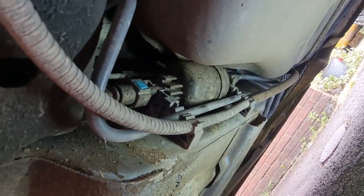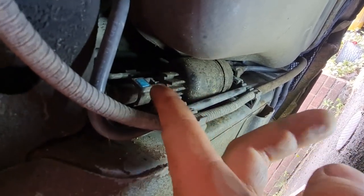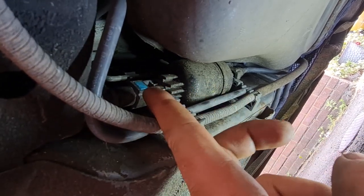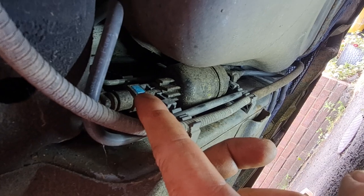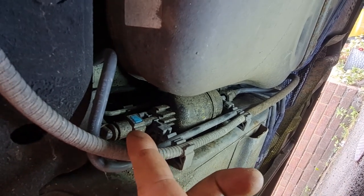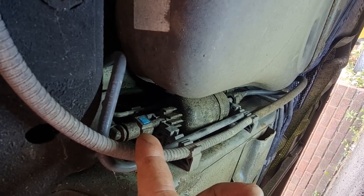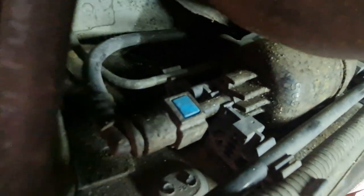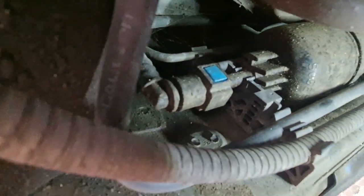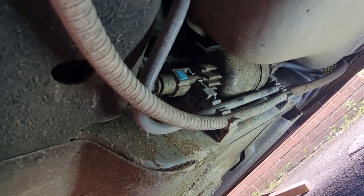We are on the passenger side rear of the car - that is your fuel filter, just there, this little canister here. It's just clipped in on two clips either side into a little holder and it's got a quick release on both sides. What I'm going to do is soak those before I touch them in WD-40 because they do have a tendency to get stuck, and I don't want to have problems getting them off and breaking things. You can see the little blue tab on that quick release - you just have to squeeze one of those in on both sides and it should just pull off. I'll come back to you when I've got a bit more progress on getting that out.